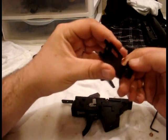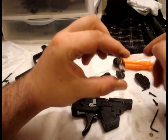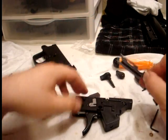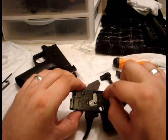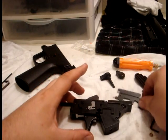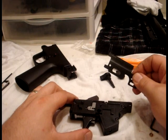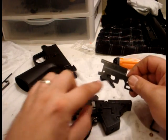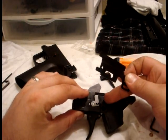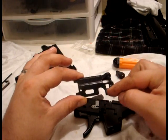On the inside of this plate there is a tab. You see a little tab sticking out? On that tab is a dimple. The dimple has to go on the end of this spring right here, and it compresses the spring. As you're compressing the spring, the trigger has to be pushed forward, just like this, to allow enough clearance to lock the plate in place. At the same time, each of these posts — there's a big one and a small one. The big one goes in this groove, the small one goes in this groove.